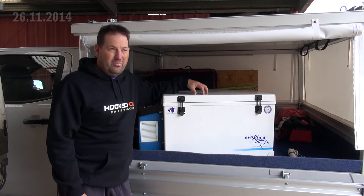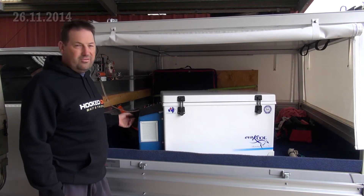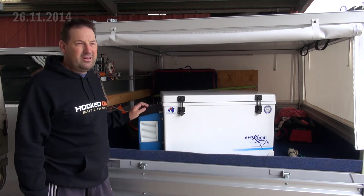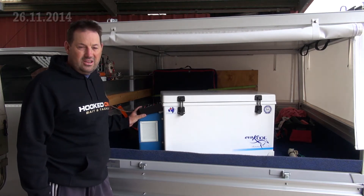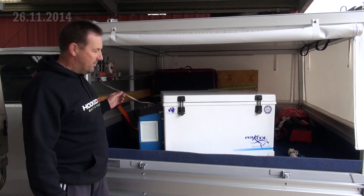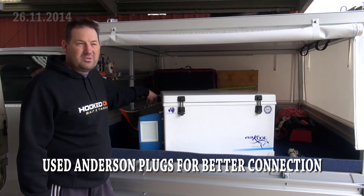We've found a few minor faults, firstly with the lighter wiring they have for the power supply. You get considerable voltage drop even from your plug to the compressor itself — the wires seem to be a bit light. Especially when you're out bush for a few days, you want to use every bit of usable power and not waste it on unnecessary voltage drop. So we've beefed up the wires externally and also internally put heavier wire in from the plug to the compressor, just to eliminate as much voltage drop as possible.